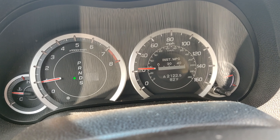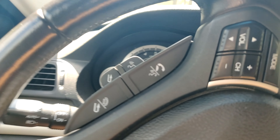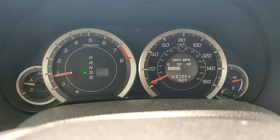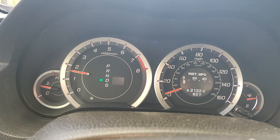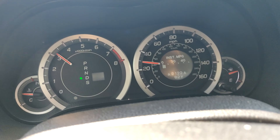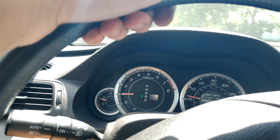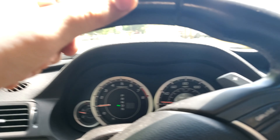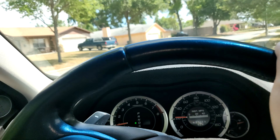For now I would say the issue has not been resolved. It's definitely still there. I guess this is good maintenance — it's good to do for maintenance but it will not fix my idle vibration. The next thing I'm going to do is probably a compression test to see how the engine health is, because it does burn a little bit of oil as well. I suspect the engine is a little bit worn.